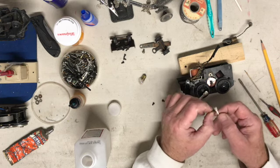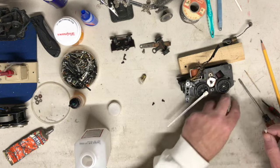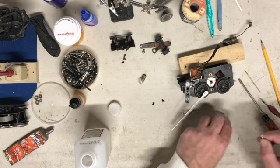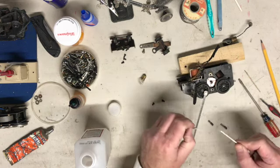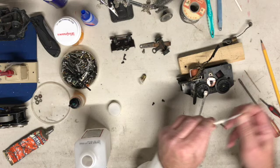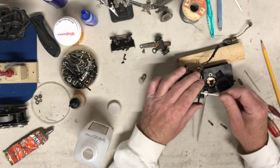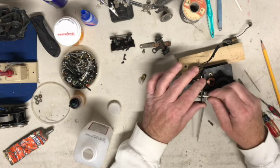Clean them up a little bit. Clean those up. Get that black stuff off of there as much as we can. Alright, let's see what this looks like in here. You might want to pull a little bit of this off the Q-tip. Oop, I really cleaned it off that time. Let me get a little bit off of this one. The good side, pull a little bit of the fuzz off and dip it in your alcohol or your engine cleaner, whatever you're using, and get it in these brush holders, because the better the contact with the brushes to the holder, the better.